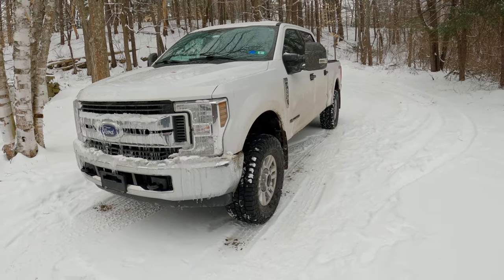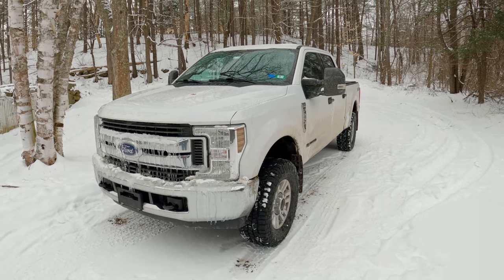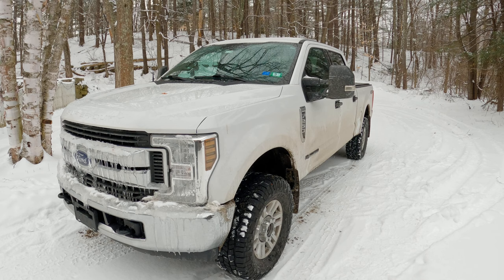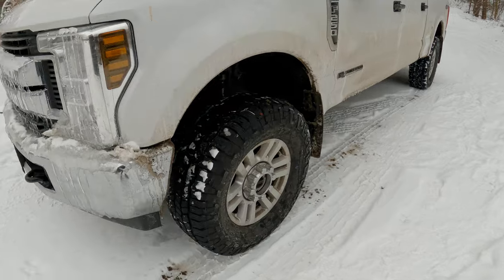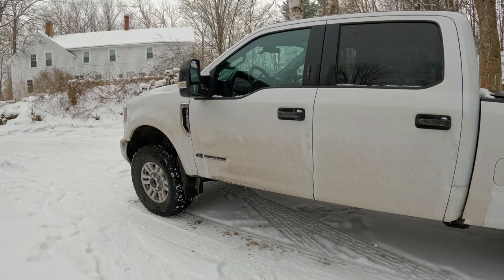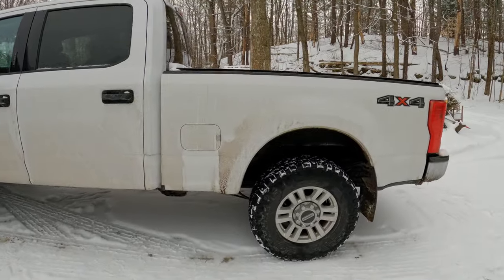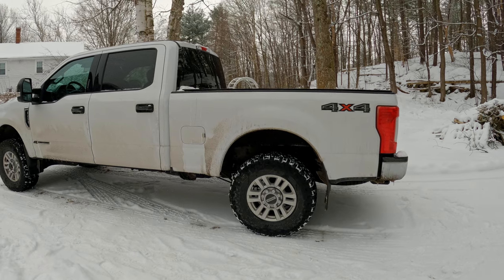The last thing you can do - and this is probably a little bit more expensive - is get aftermarket tires. Or even with your OEM tires, figure out a way to use FORScan. Go to an aftermarket shop or buy it yourself - it's about $60 for the dongle and $12 a year for the software - and lower the TPMS threshold light in your BDCM module. You can go in and lower the TPMS light threshold on your truck without having to go into the as-built in FORScan and know the actual codes.